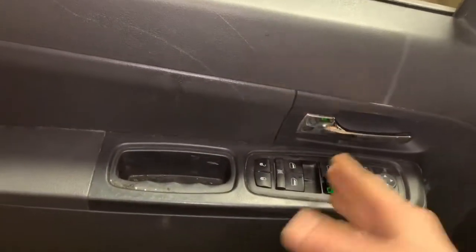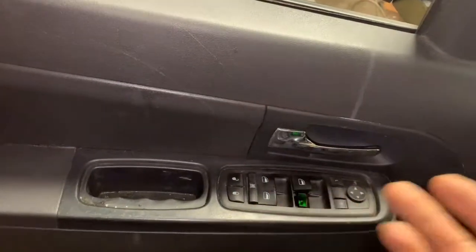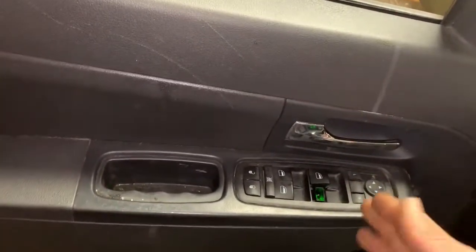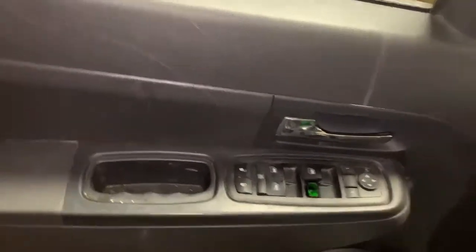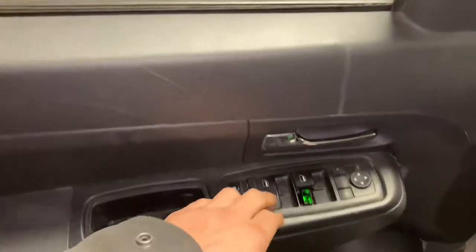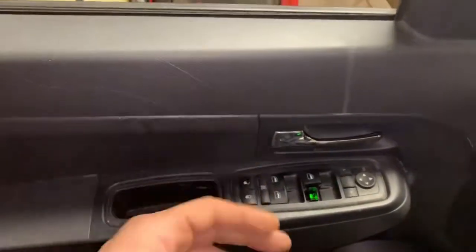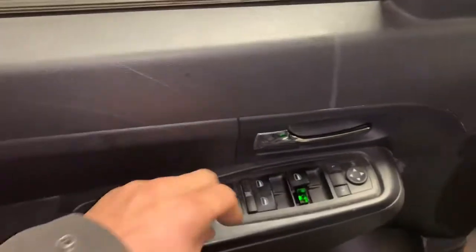A lot of people will go out and buy a $75 switch, and that's what this switch costs. I will tell you, you can take it out and disassemble it, and you can probably clean up the contacts and put it back together. Let's face it, you can't break what's already broken anyway. So if your switch is doing this, I highly recommend you take the switch out, disassemble it, look at it, figure out how it works, try to clean stuff up, put it back together — you have nothing to lose but a little bit of time.